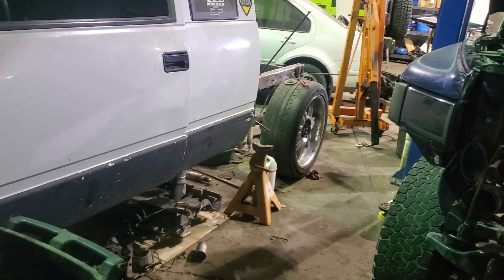Really all the back is what's changed. The front — I showed you guys the front when it was done, there's no more parts to do on the front as of this point. I've been talking to a good friend Nate Hills, one of the OGs, and he turned me on to an idler support from Super Steer, which I'm gonna get one of those coming on Friday. And Cognito makes a set of Pittman and idler support brackets, which I will be getting. Then this front end will be about as bulletproof as you can get for a GMT 400 truck.